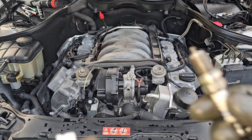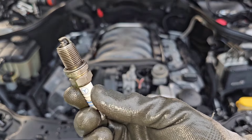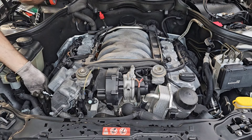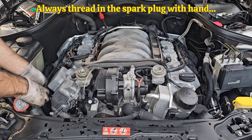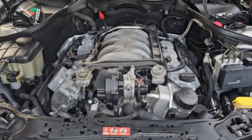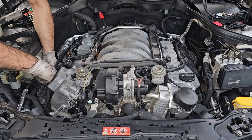This is why I love to keep some of my old spark plugs at home — in case you break one. I'm going to install this one at the front, and next time, maybe next week, I'll buy a new one and replace it, but this is going to work for now. Okay, let's go ahead and put back all the spark plugs. The torque is 25 newton meters.